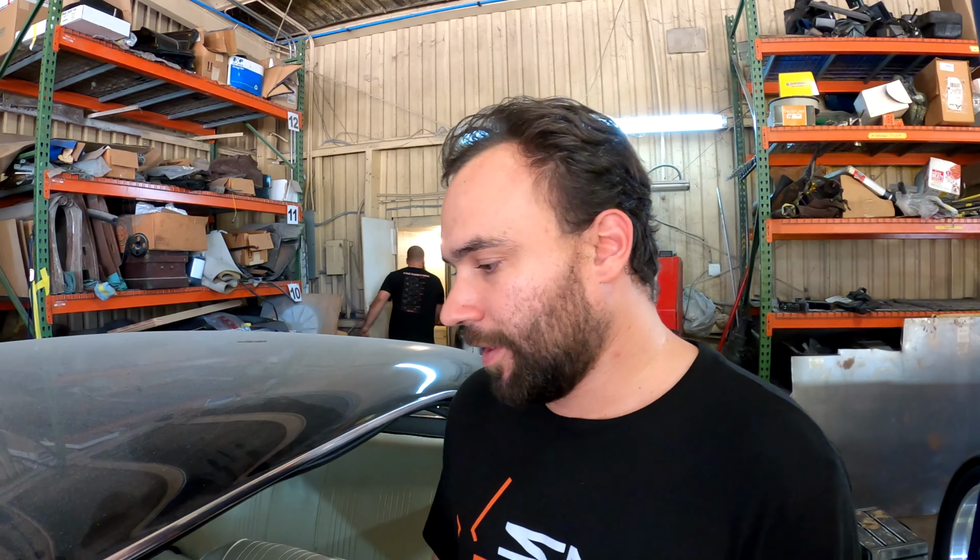Target AFRs, I'm going to try to lean it out, get some better gas mileage, better drivability. I'll smooth the timing tables out, change some startup stuff, some throttle enrichment, so it should run and drive like a brand new car does. I try to eliminate some of the exhaust smell that most people smell. It's typically because these older style cars like to run rich, but with modern electronics, you can lean them out like newer cars, get a little bit better gas mileage, and be more friendly to the environment.